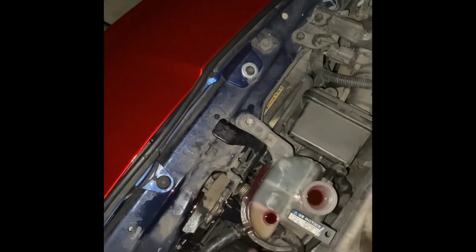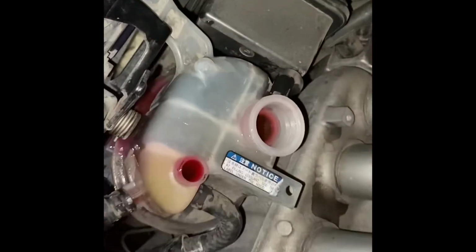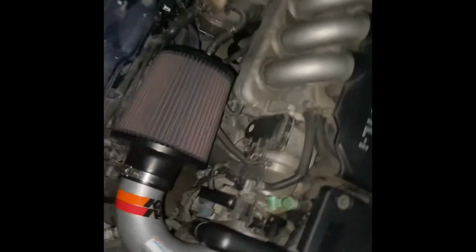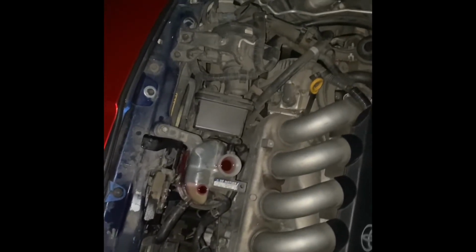It's blowing out. That's taking all the air from the top of the radiator out through this right here, and that's called burping. As you can see, it should be blowing, and once it blows some out, go check the temperature. Like I said, always make sure it doesn't overheat. It hasn't been 10 minutes yet, and it's already burping, but after 10-15 minutes, I'm gonna turn on the heater to make sure it's throwing out hot air.